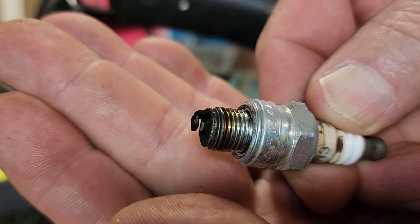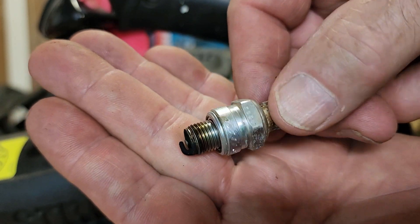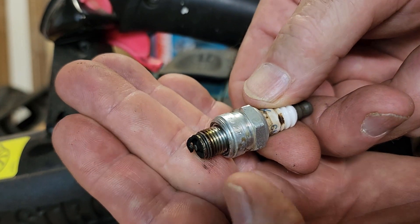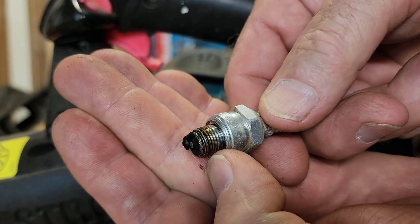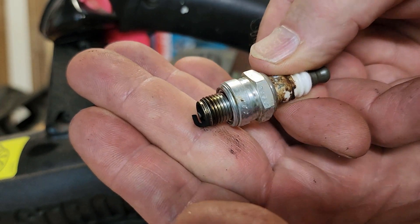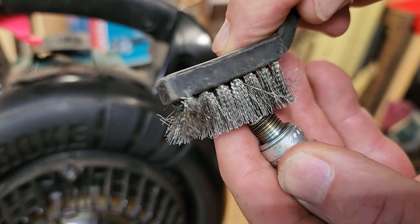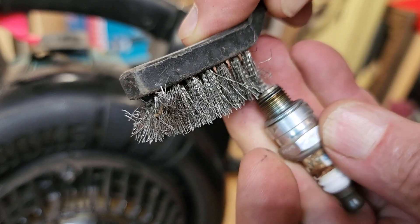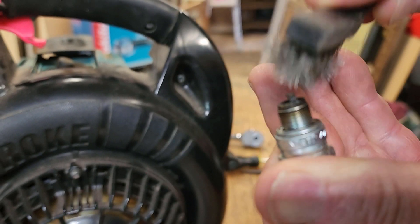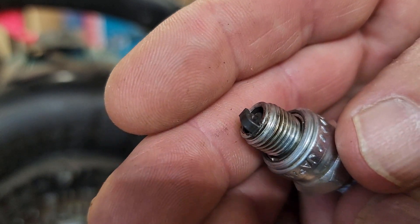The spark plug gap's quite large — I would say that's probably a little bit large, but it's not wet. It doesn't appear to be pitted. If you use ethanol fuel in a small engine you sometimes get strange deposits on the spark plug; if they've been running very hot it'll look whitish. It looks pretty good. I'll give it a quick cleanup and maybe close the gap just a whisker — I'll scrub it with a fine wire brush to clean any carbon out from around the spark plug. This engine has hardly done any work at all.